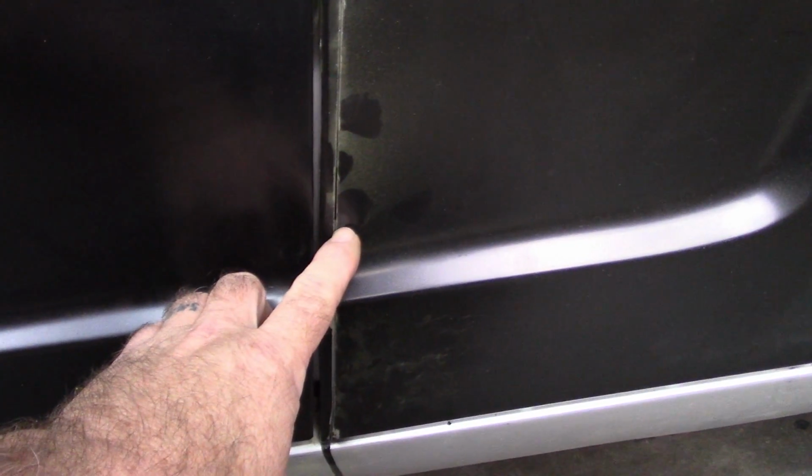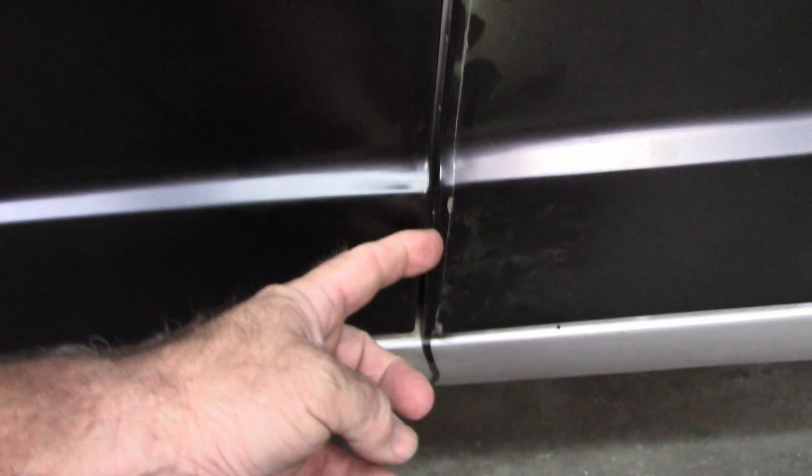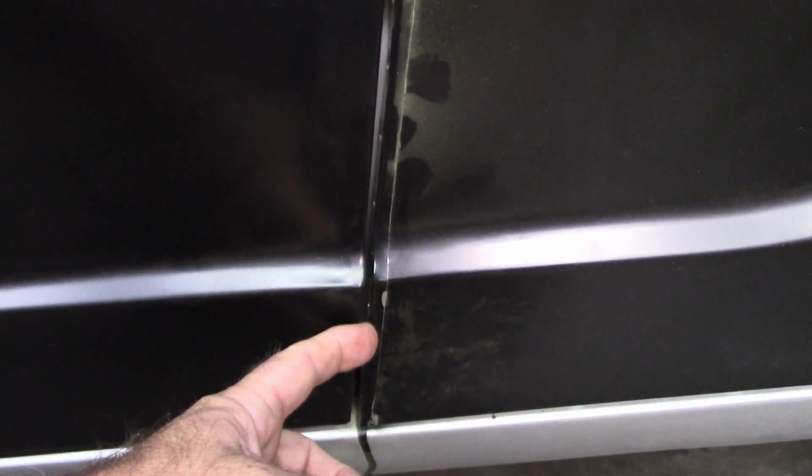I can actually get behind that and pull it out, and there's no adjustments needed. It fits flush like it should, but again, in case I need to do some modifications, that's why I did not weld that. So at this point, you can see I've already done cutting with the cutoff wheel, and I will trim that slightly and get that to fit, and then tack weld that all back together until I'm comfortable with the gap that I'm looking for.